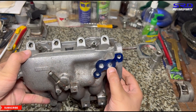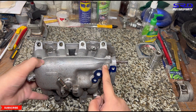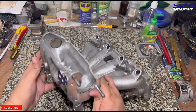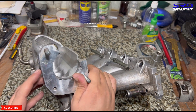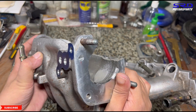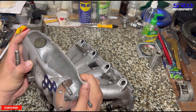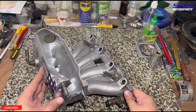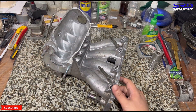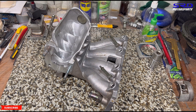On one side we go in halfway and then turn toward the throttle, because the IACV port has to breathe through the throttle. Some people say you need a bigger hole, but when you think about it — even with vacuum lines — if you increase the size you weaken the signal. So opting for a bigger IACV hole isn't necessarily better; it's got to be managed with the tune.